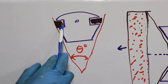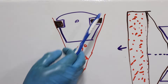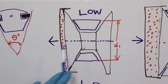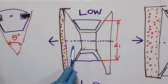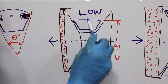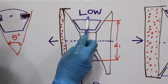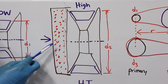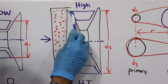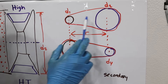Here's a little explanation for the bookworms out there. Here is a cross-sectional view of those 300-something pieces that make up that CVT belt. Here are the two steel belts on the outside that hold everything together, and there's also an alignment dot. All of them come together to create a cone angle which is going to match those on the variators. Here's a cross-sectional view of the variators — this one is the stationary side and this one is the one that moves with the piston. If we relax all the fluid and allow the variator to come out, the belt tends to drop down — you've got a large gap, giving an outside diameter of D1 for a low drive ratio. When the valve body commands a lot of fluid inside this piston to push the two variators together with a very small gap, the cone angle pushes that belt out to a much higher diameter D2 for a higher drive ratio. The length of the belt and the distance between the two variators never change — there's no stretching of the belt or any magic tricks.